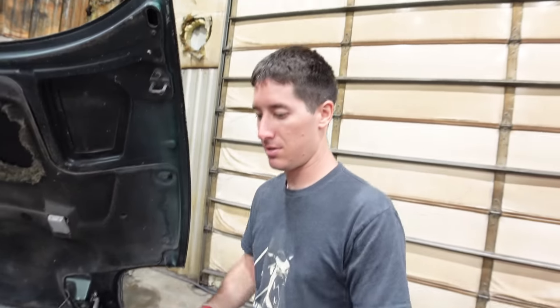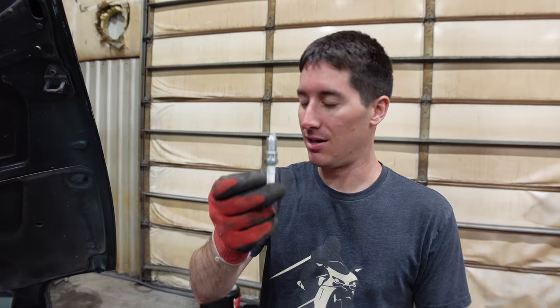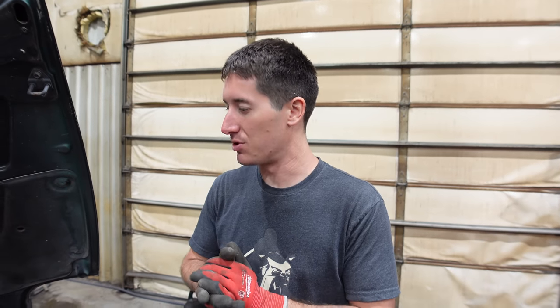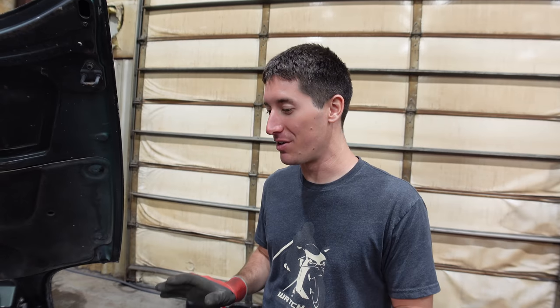So we're still putting plugs in and going with NGK G-Power Platinums — I'm a big fan of NGKs. The AC Delcos were probably actually fine as a good platinum, but we'll swap all of these out with new plugs and new wires. Hopefully no more misfire, if the bad wire didn't kill the coil. There were no coils in stock at O'Reilly's today, so hopefully this knocks it out.